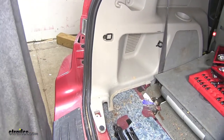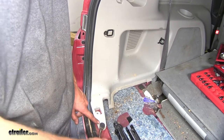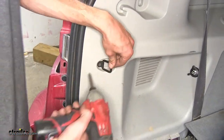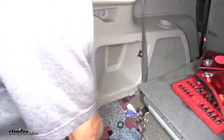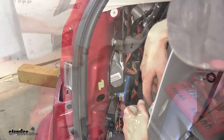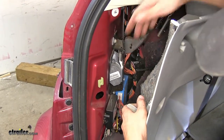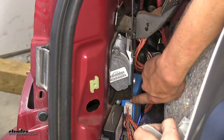Now we need to pull back on our interior panels. To do that, we need to remove a couple of fasteners — we have a push pin fastener here, which we'll pop up with a trim panel tool, and then we have a screw that holds in our cargo net hook. Now we can grab our panel and pull it back. On the driver's side behind the panel, we need to remove our seat belt assembly here temporarily. There's a 10-millimeter bolt on the top — we'll remove that one first. Then at the bottom, we have a T-50 Torx bolt.